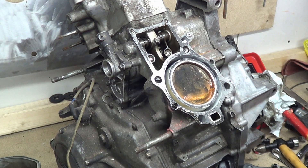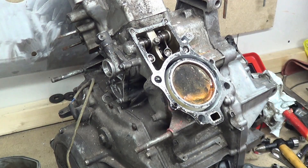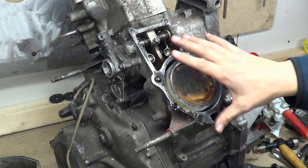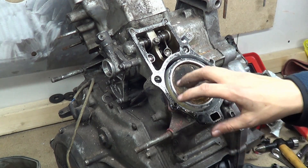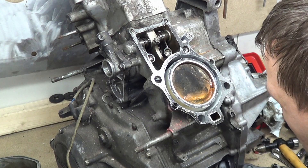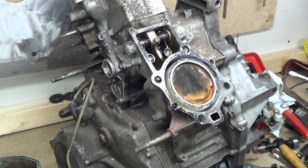There are loads of what looks like mushy calcium deposits in the water jacket, so that's going to be a beast to get out. One of the biggest problems with this engine is that there's no separate cylinder liner - the cylinder is actually inside the block - so we have the problem of getting that out. That piston is foobard and the cylinder is probably foobard too.